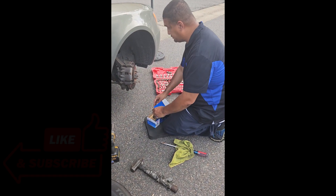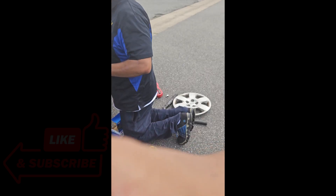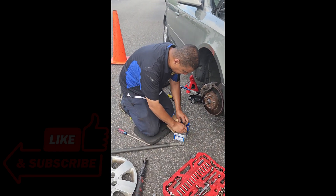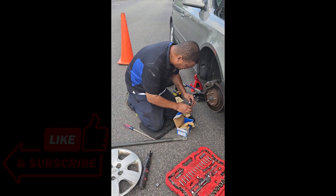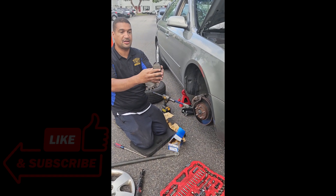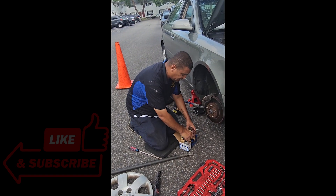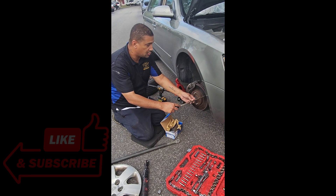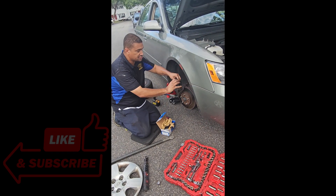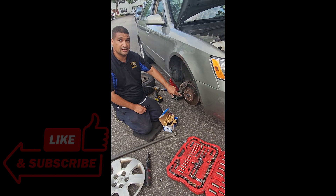Come over here and look at this. If you drive the car too much, there is a little piece on the brakes — right here — that is squeaking on the rotor. This little piece is telling you: you must change me. That is your free warning. If you do not change the brakes and they start squeaking and then grinding, you're going to do what's called a Saturn pattern right here — now you're eating inside the rotor. When brake pads go bad they make a squeak noise; when you choose not to change them, it makes a grinding noise, and you've gone from a $100 job to almost a $500 job.